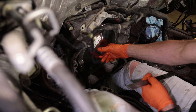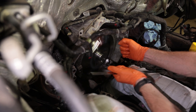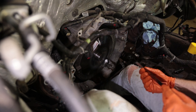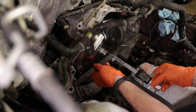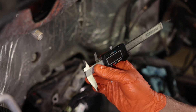There are a few tiers on the input shaft you need to get through, with three missing splines — one every 120 degrees around the full 360. That's why you need to slightly rotate and push in, rotate a little more, and push in until it fully engages. After confirming with the straight edge, our measurement is 34.1 millimeters compared to the original 33.96 millimeters — definitely within the margin of error.